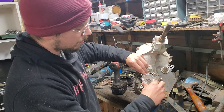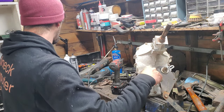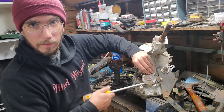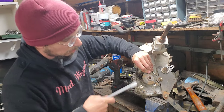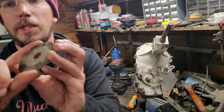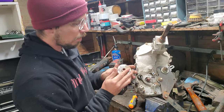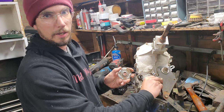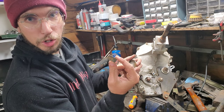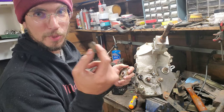This is going to come off next — that's your brake rotor. If it's rusted on the end like this one is, you're going to need to just tap it with a flathead. These brake rotors are different than on a geared transmission — if you look on the inside you're going to see they are really large on the spline. And there's your other brake pad. Just a reminder: a drum brake has shoes, but these are rotors which have pads.